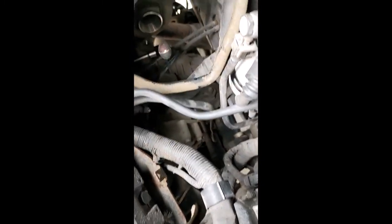I'm making an effort to help you guys find it easier. I've put my ratchet on the bolt itself — as I said, it's on the engine block all the way down there. I hope you can see something. That's what the crankshaft sensor looks like, close to the flywheel on the engine block. I have to admit I thought I'd be able to do this from underneath, so I lifted this car on axle stands, which made it very tall even for me — and I'm six foot seven.